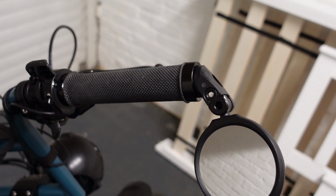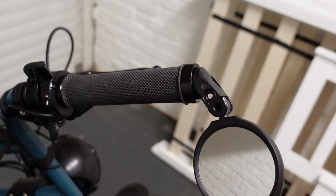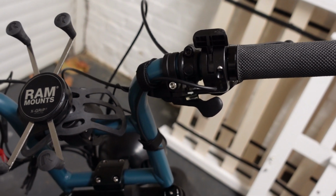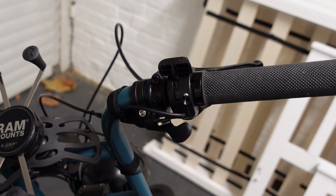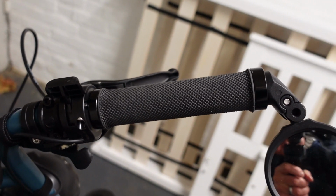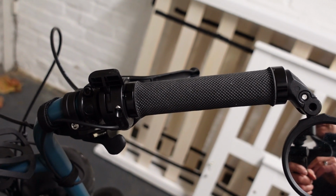That rubber part of it doesn't actually touch the handlebar. Inside there's a vinyl sleeve, so all you need to do is loosen that off, pull it off, and then down here in the other part of it you've got the gears that you see, the levers underneath, as well as the brakes. I loosened those off. I pushed them, just slightly nudged them to the left, and that gave me the room to put the throttle on here, and then refitted the handlebar, and that works just fine.